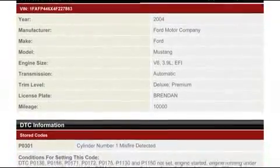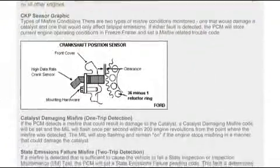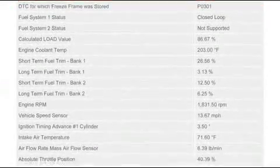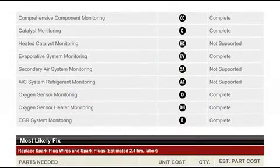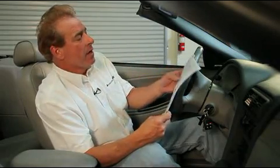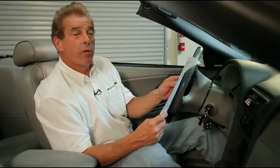So let's just take a look. At the top we have the vehicle make and VIN number. Below that we're going to have the DTC information — this is our problem code. On our next page it's going to give us some definitions of what to look for. On our next page it's going to give us the freeze frame information — this is the same that was on the unit. And then it's going to show our emissions monitors: some are completed, some are not supported. And then what I've done is I actually paid the extra money to see the most likely fix, and it says I need an O2 sensor — right on. It'll also tell me TSBs and if there were any recalls on this vehicle, and it also tells me the tools and required procedures.